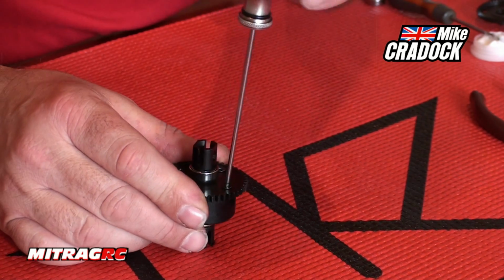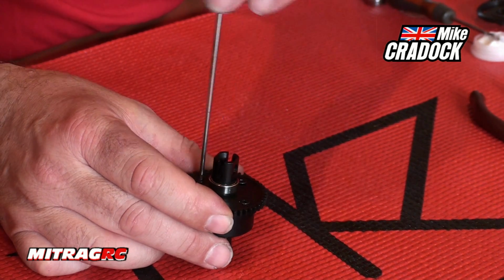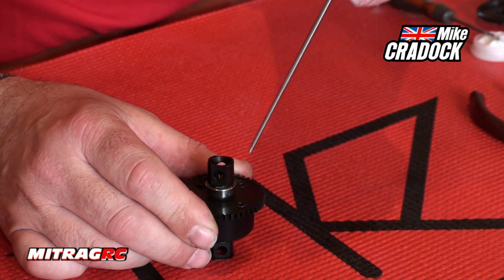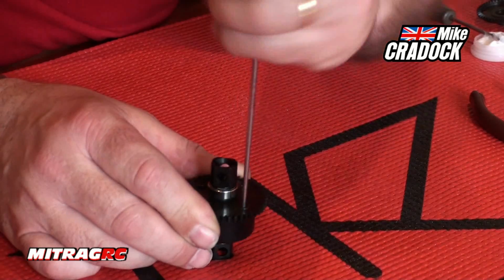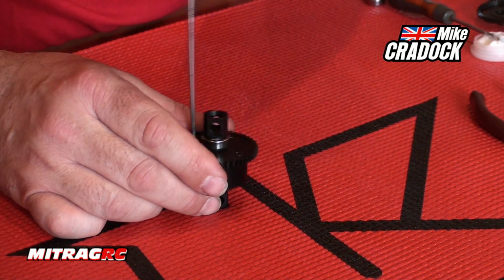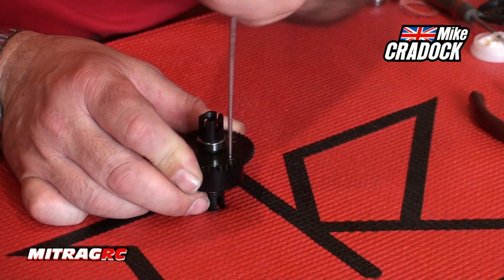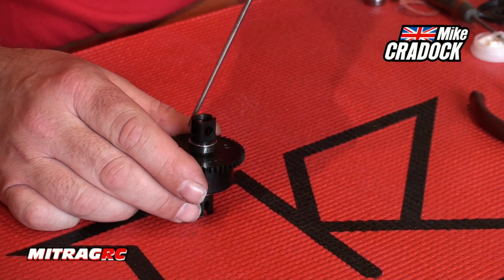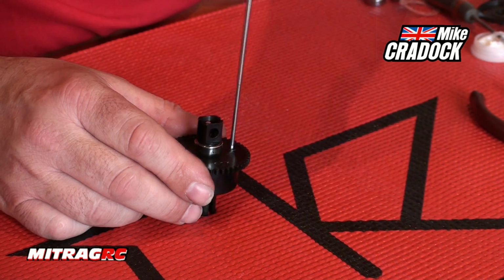So once you get it near tight, you set the first one down. So it just nips up tight. Then you do the second one across. And across. And across. Just nipping them up tight, not over tightening them. And again. Turns freely. Then nip, go from one screw across to number 2 screw. And again, this is just seating down until it starts getting tight.